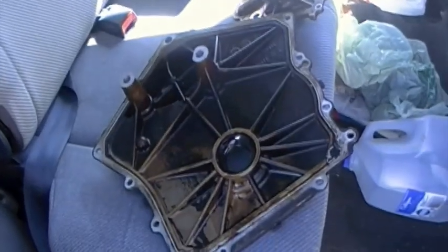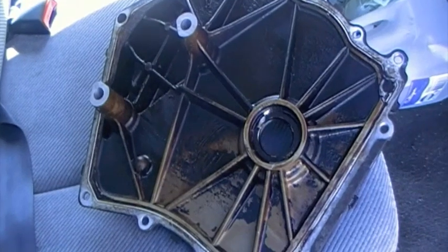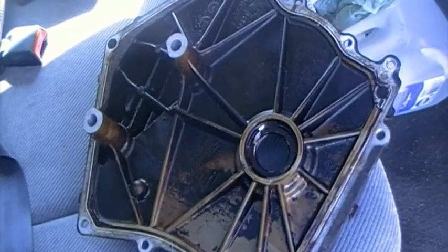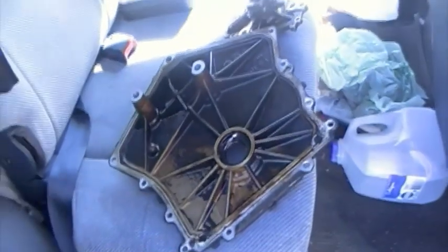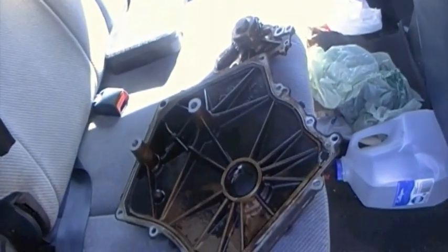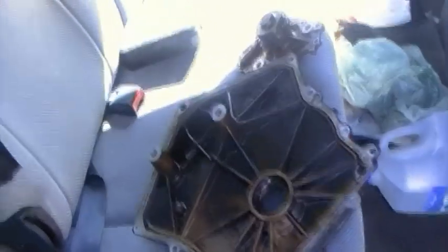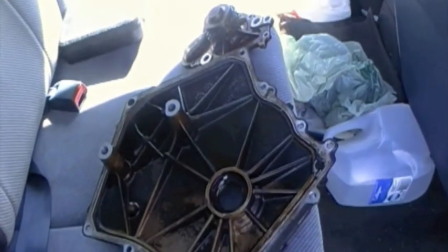At the beginning of this video, you'll see that when I was first disassembling this motor I was wiggling the timing chain - that's because the primary timing chain tensioner wasn't tight enough due to lower oil pressure. That's when it gets really risky: you can jump your engine timing and bend all your valves. Some of you watching might have a dead 2.7 - you were driving along and suddenly the engine died because it jumped time and the timing chain tensioner went bad.